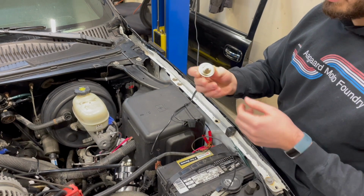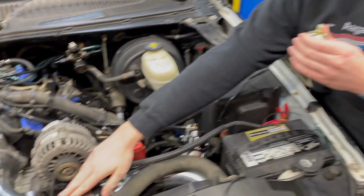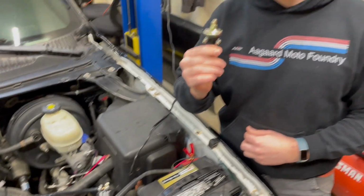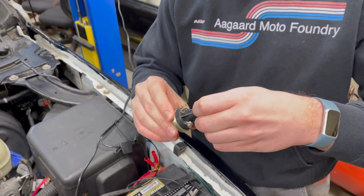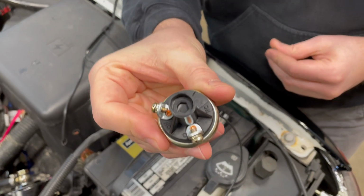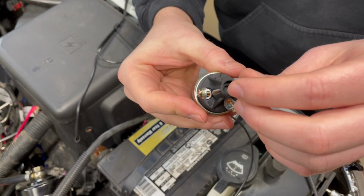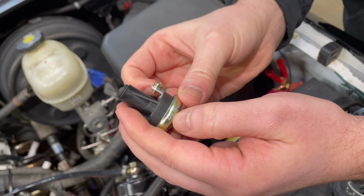So what this switch does is that it'll be in my intercooler piping in this location over here on the bottom side. And this switch, when it sees a certain pressure that I end up setting up, then it closes. And then that fuel pump will kick on because you just close the circuit to ground. There is a cover right here on the top, and this cover comes off, and there's an adjuster in there for you to adjust the pressure. So you can pick these. It looks like this one says 4 PSI. So that's the lowest that it can go.